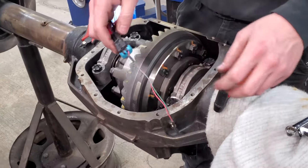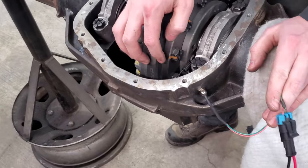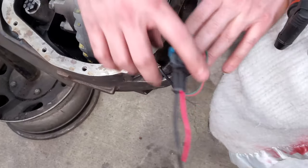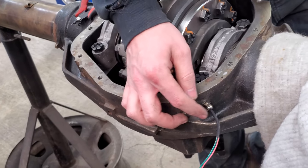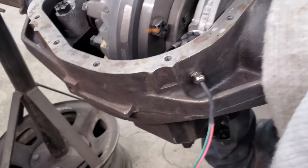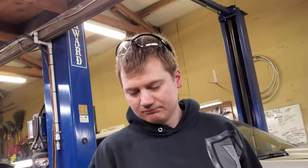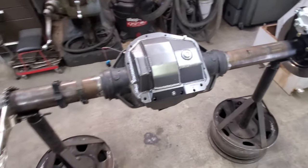Wiring is pretty much done now. I got a two-wire connector from the parts store, cut the factory connector off that was really close to the locker, and just ran some longer wire so I could have the connector out further. I soldered the wires to the original two wires, then put some adhesive shrink tube on and ran that through the cable gland, so it should be all sealed up. I'm going to keep working on getting this axle put in — hopefully I'll have another video out showing everything I'm doing to get this mounted up in the Colorado, so stay tuned for that. Thanks for watching.